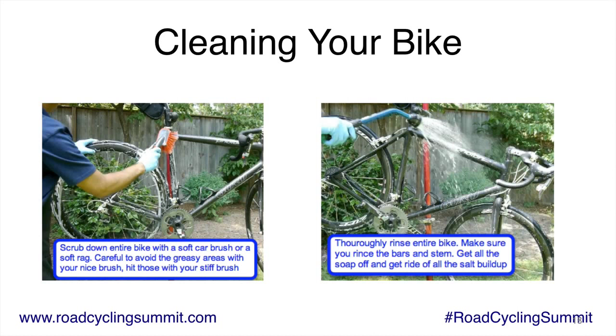Okay, then I have, see that brush? It's a regular automotive car brush. Those are fantastic. They're cheap, and I really like them. I have my soap and I scrub the bike down. You want to make sure that you don't use your nice clean brush on the greasy stuff on the drivetrain, because if you do, you're going to smear that grease all over the frame. So I avoid that area and scrub down everything, the brakes, the rims, everything, especially the handlebars where you might sweat, and then just rinse it off. Pretty straightforward, right? Not that difficult.